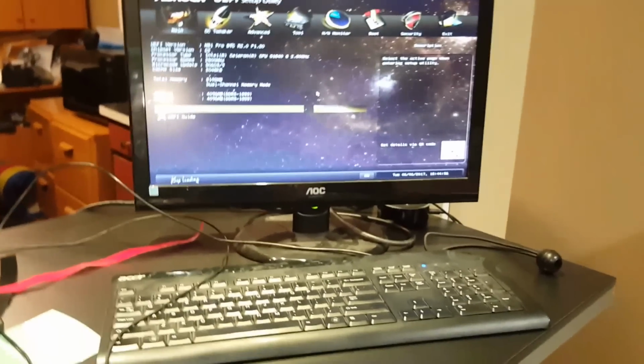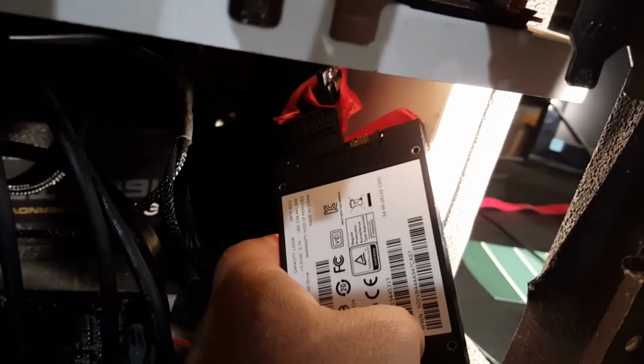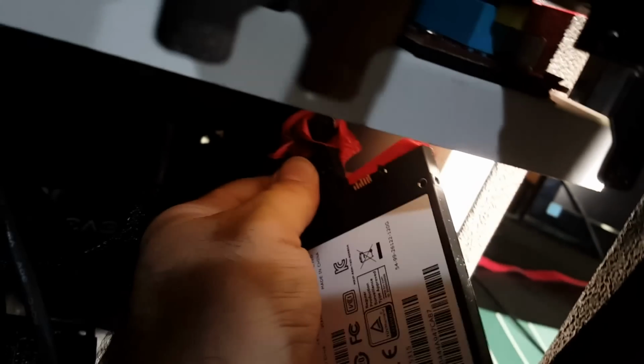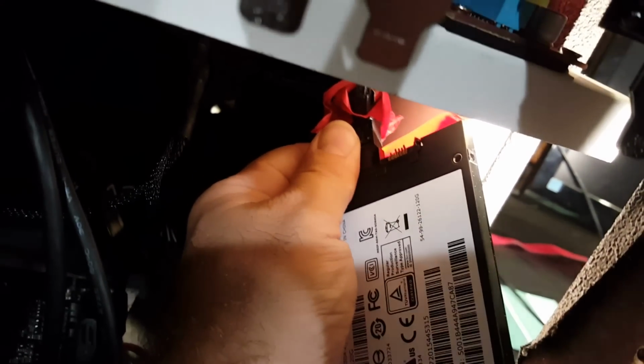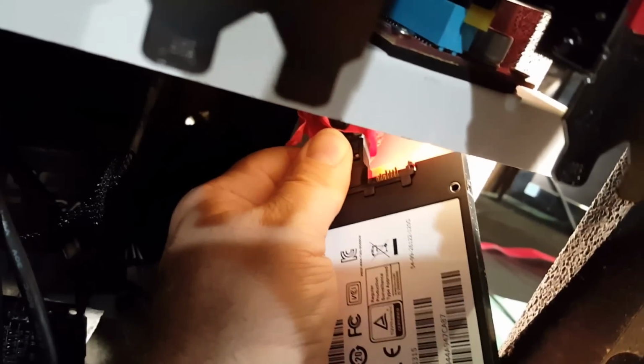Okay, hold on. Okay, you told me you messed up the adapter. Yeah, this is why it wasn't working. So what happened again? So I went to squeeze the plug onto the SATA drive, and instead of going down, it kind of folded forward and broke a little bit of plastic along the way. So I slid everything back together. It looked like all the metal prongs were lined up with the correct holes, but I'm guessing maybe not. Well, anyhow, that's why Windows wasn't loading just a second ago. But maybe we'll see if this is salvageable or not, and we'll go from there.